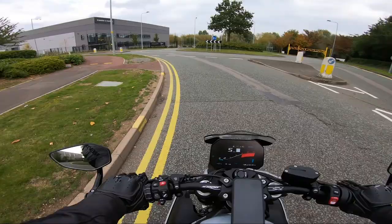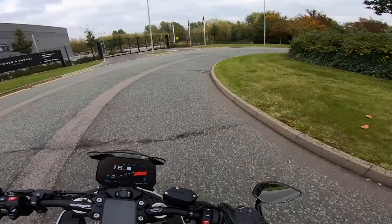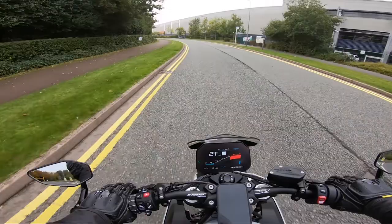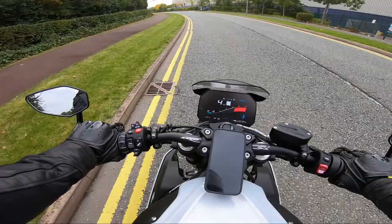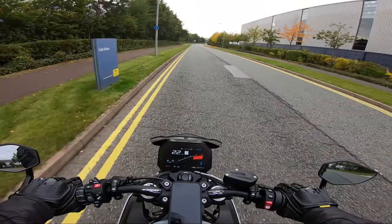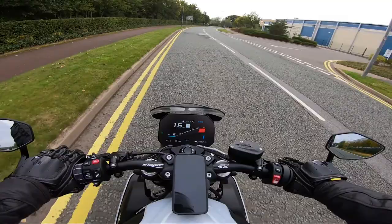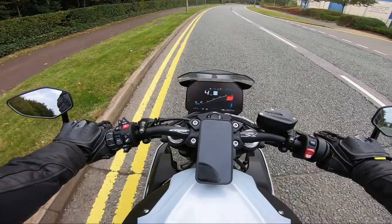You want to do that five times on your front and your rear — 30 miles an hour, as slow as you can to a complete stop or near stop, around five miles an hour or so. So 30 miles an hour, slow all the way down to a slow or near stop. For the rear: 30 miles an hour and then slow, slow, slow — we're not going fast at all — all the way down to a near stop.